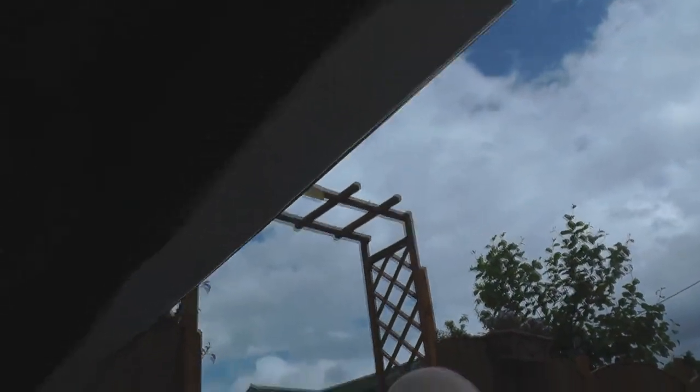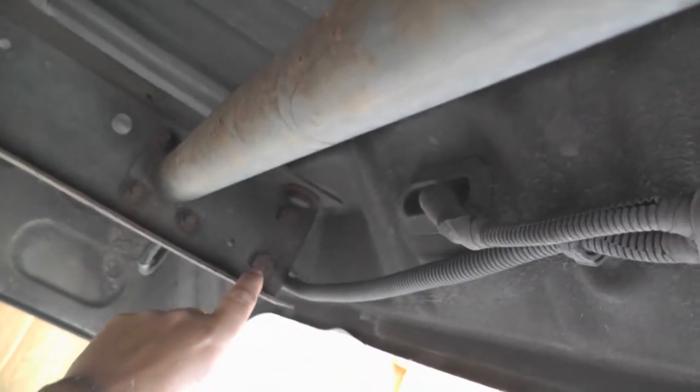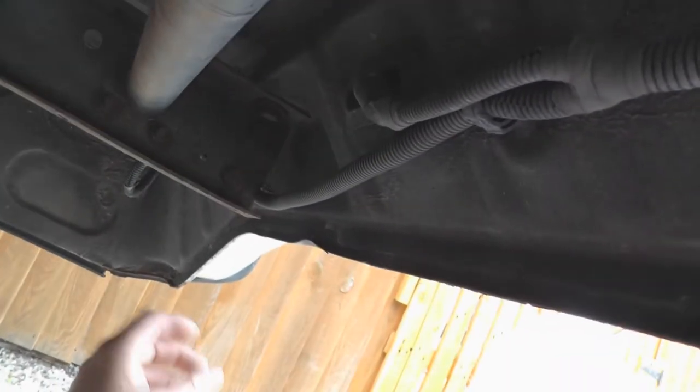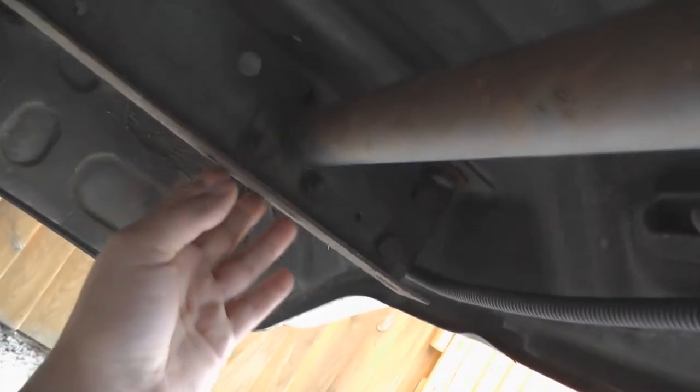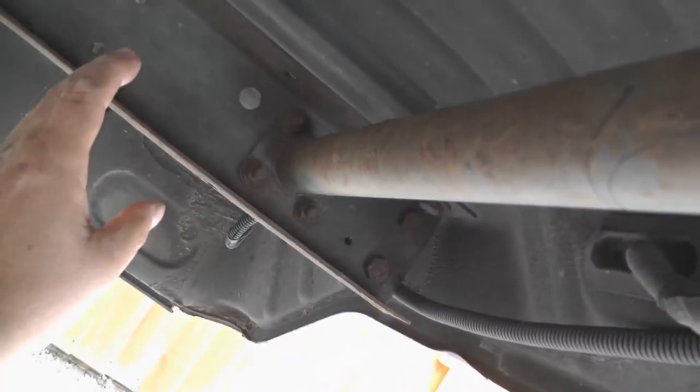And the other thing I've noticed now, this is where the bolts where the step attaches to, just there, so the bolts are already there, the step is snapped off. It's the same on the other side, so the bolts are there, so I'm going to undo these bolts and then I'm going to clean this bit of frame down and get some paint on it. Okay,